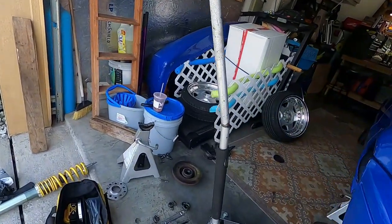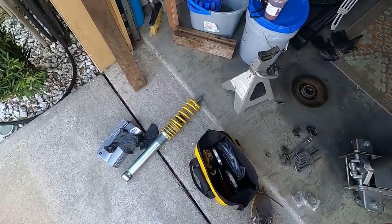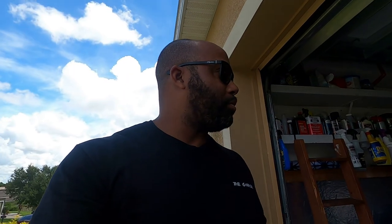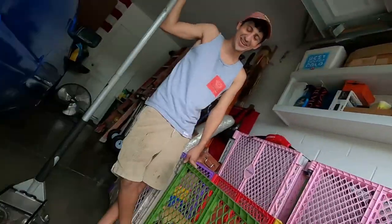I don't have tens, I have 12s here which should do the job perfectly fine. If that works for him, I'm pretty sure two 10mm spacers will do the job — hopefully it doesn't poke too much. Then he can add camber later and he'll be set. Good progress — rear beam's in. After my mistake of putting it in upside down, we're back in. Everything's tight and we're going.